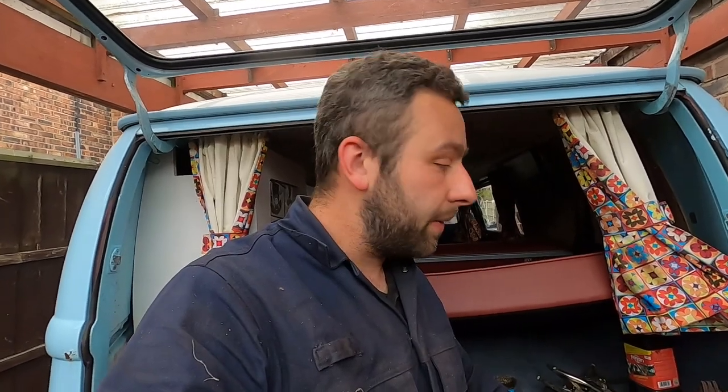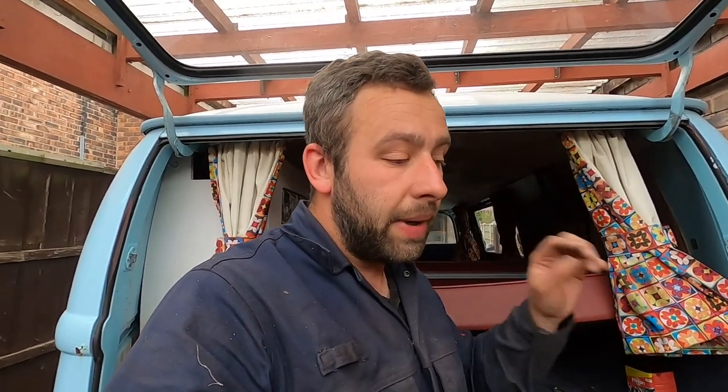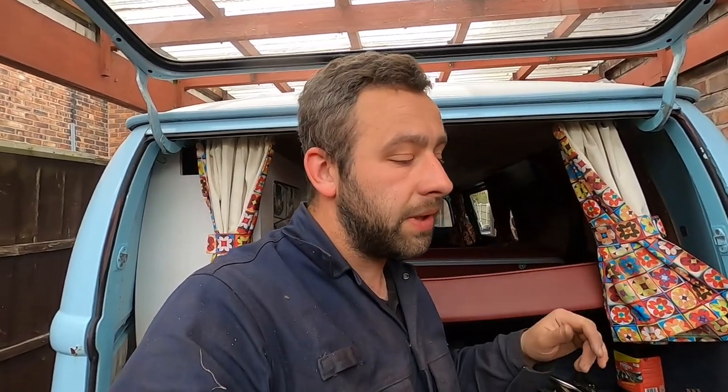I want to thank you guys for watching — it's a little bit different and I'm really struggling on this driveway. The plan is to get this side welded up, get her running and driving again, and then get her to the workshop where she can be up on higher stands so I can get underneath and make it really nice. In theory I've repaired the bottom of the outrigger, inner chassis rail and inner sill, and I've still got the outer sill to put on. This is not a restoration — this is a rusteration. I want to get her solid. She can be ratty-tatty but she just needs to be safe and solid.